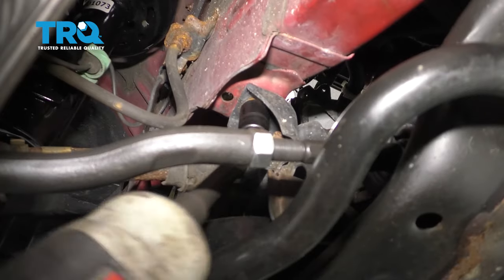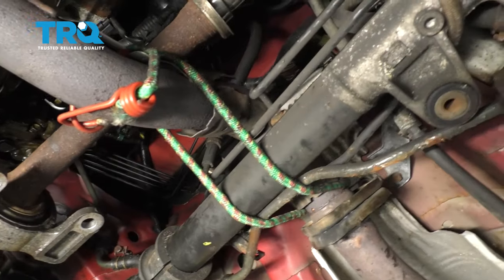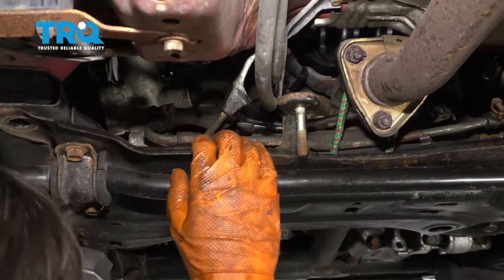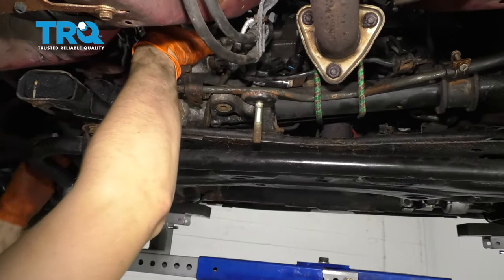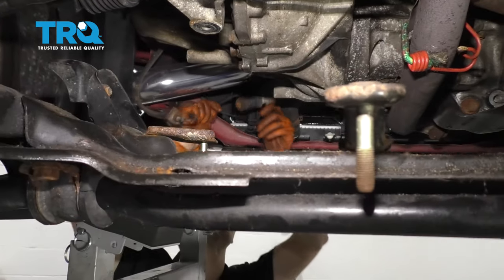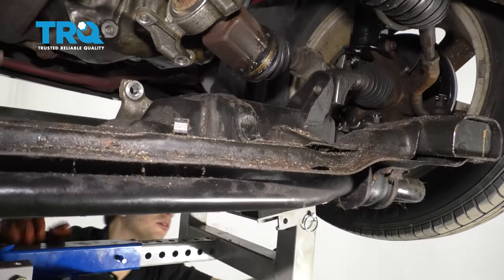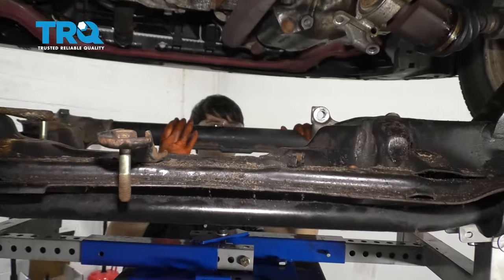These are short — one on each side. I tied up the steering rack with a bungee cord around the exhaust and another one hooked onto these. These are not the best points to put pressure on, but I just want to make sure this doesn't fall down and extend your steering shaft. At this point you can go ahead and lower the subframe. Make sure that this slave cylinder doesn't fall down and tear itself out with the subframe. Push the wheel out and lower this down all the way.